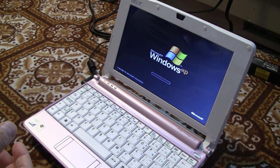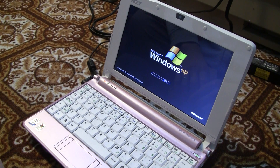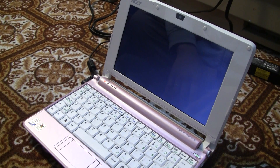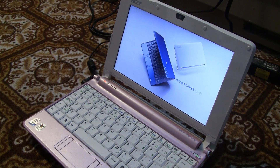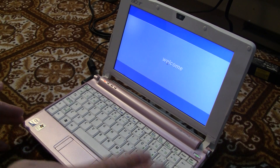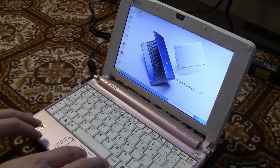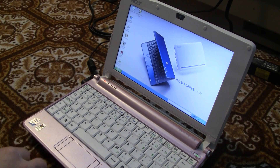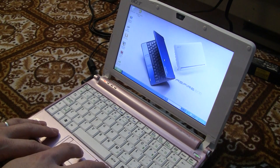So what we need to do: if your laptop is still working, turn it on. If you still have internet access, go to acer.com to download the latest BIOS file. Once we download it, we're going to flash this computer. If it's not working anymore or there's no internet connection, you need to download from another computer and use a USB drive to transfer the files to this computer. Fortunately our computer is still working and we have Wi-Fi, so we're going to go to acer.com and download it.